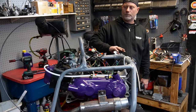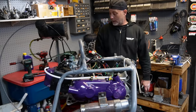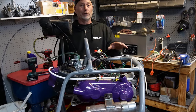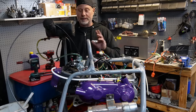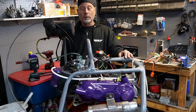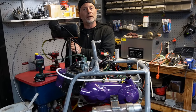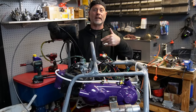What I'm doing is getting the oil pump circulating oil up to the top end. I already pre-oiled it before we started filming. Normally when you first turn the motor over, you'll actually hear it tend to speed up a little bit, and that kind of lets you know that the oil is making its way up to the top and everything's getting less friction.